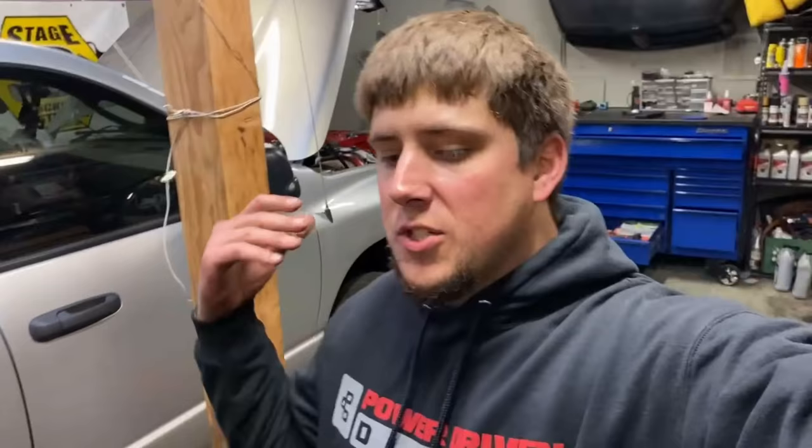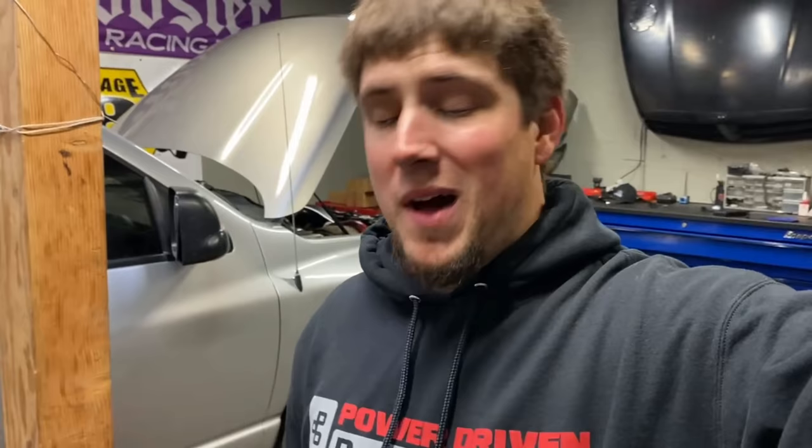So we're gonna wrap this video up. We got our protrusion measured, cam thrust, crank thrust. We got our rods, pistons, wrist pins, rings installed in the engine, cam tappets, J-jets, cam retainer, all installed in the engine as well. That's pretty much how I would expect a short block to come into me. Maybe an oil pan pickup tube, but then again, it just depends on who you buy it from.